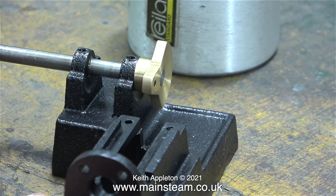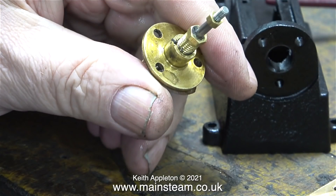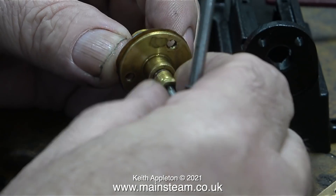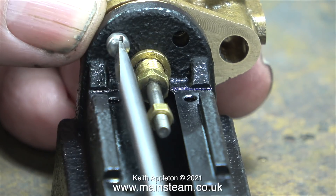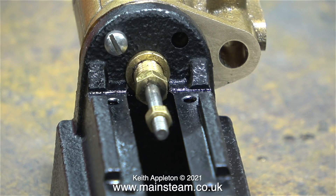After cleaning away the paint particles I re-oiled the bearings and now the crankshaft is in place. It's time to look at the rear cylinder cover — this has a gland nut that seems to stick out a long way, but that's not a bad thing because the gland nut will support the piston rod. I'm checking whether the gland is packed and it appears to be packed with some sort of nylon or PTFE material. The running order of the assembly sequence is quite important. I've loosely placed the cylinder in position followed by starting to bolt the cylinder to the main bed, and as I mentioned at the beginning I'm temporarily using these slot-headed bolts. I'll make some hexagon bolts in another episode.